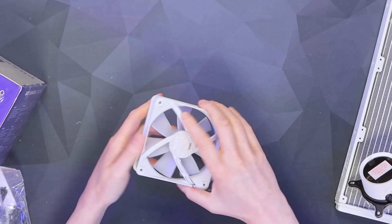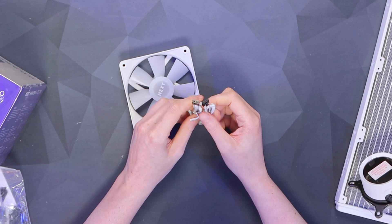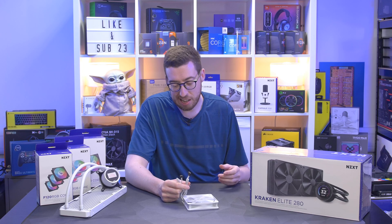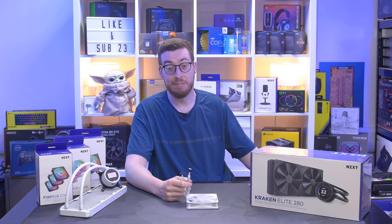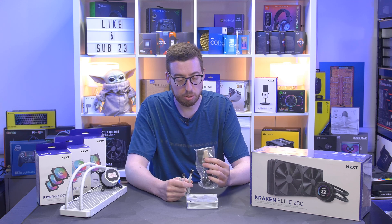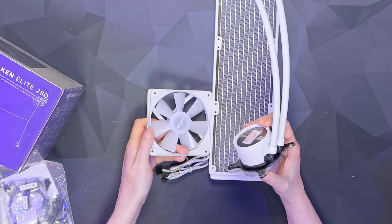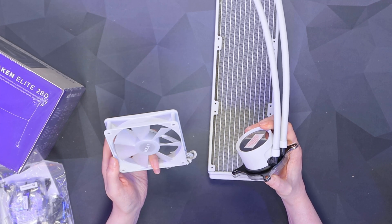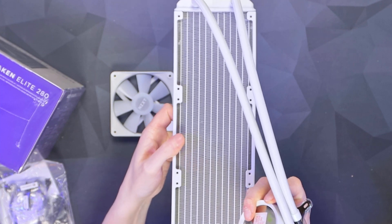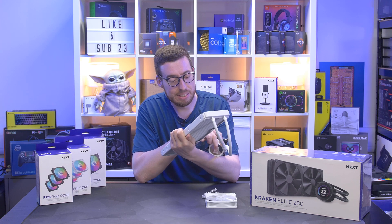I want to quickly look at the fans. As I mentioned, these are the new Core fans - RGB in the hub that goes outwards rather than a ring light we've seen on most ones before. On the end we have a four-pin PWM and then there is the proprietary connector for the RGB. It's a bit of a shame that's gone with the hub - I would like to see a standard connector. But NZXT do have their motherboards with headers built in, and you can actually use standard 5V on there as well. Also there are fins underneath the screws so make sure you don't go too deep with them.